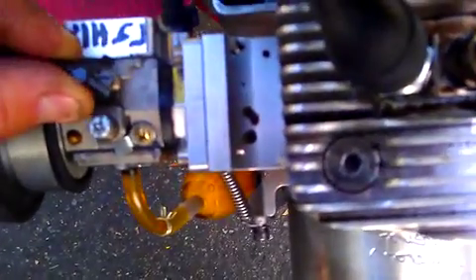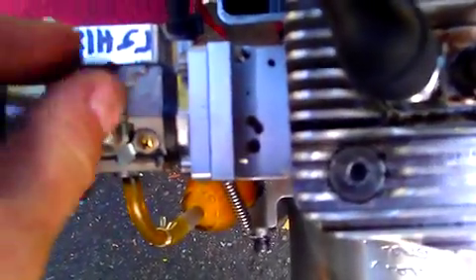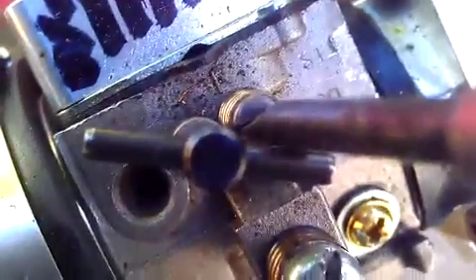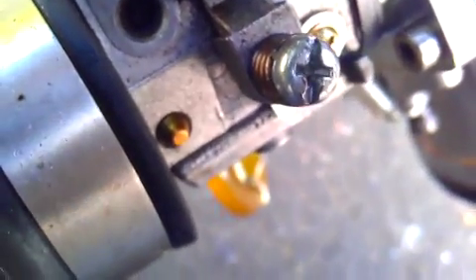This is half one — it just likes one turn out exactly on the high. So half one, and you can even tell there's a little bit of richness there. Using my special lucky screwdriver, we'll see exactly what we got on the low. So counting the turns: half, one, one and a half, two — that's what seems to get the best power.